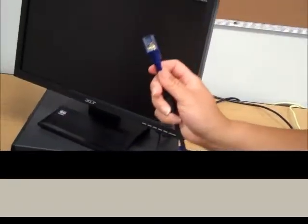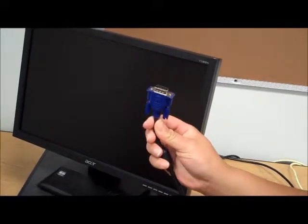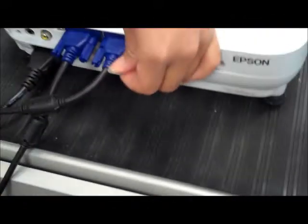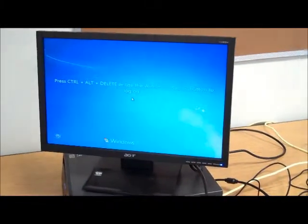The image will not appear on the monitor because you took the RGB cable out from the monitor from the CPU. But what you can do now is take the monitor RGB cable and go into the projector monitor out. This creates a circuit going from the computer to the projector, from the projector out to the monitor. As you screw this in, you can turn the monitor on and you will soon see the image appear on the monitor as well as on the screen.